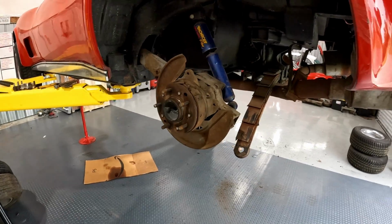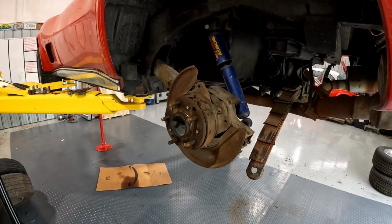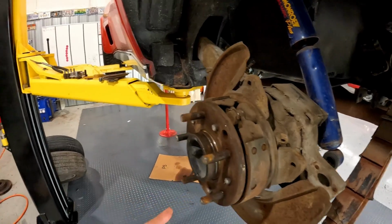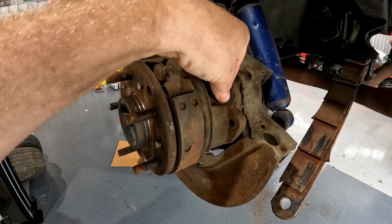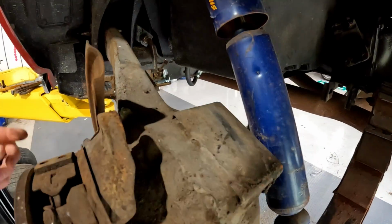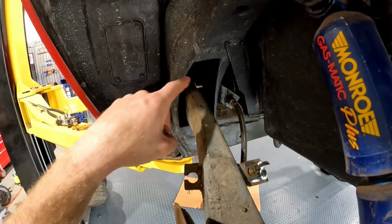All right, the trailing arm rear suspension fiasco has come to an end. There's the originals, here are the good used ones. So again, put a new stud, now I have 5 studs, check the parking brake. It now has parking brake hardware and new springs top and bottom, whereas those had neither. It has a good brake dust shield that actually will hold the parking brake hardware in, so we can use that. The bearing on it is good. It is rust free, it is straight. It also has all the appropriate brackets for the parking brake and for the brake line itself. And we now have good bushings inside the trailing arm.